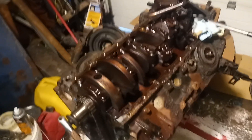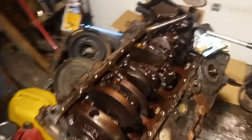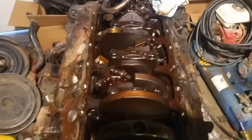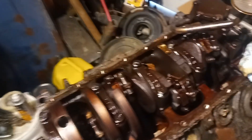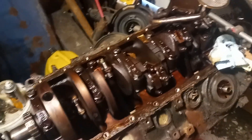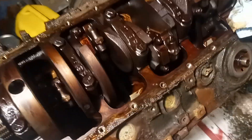Personally, I don't care what the manufacturer says with their 5W-20 — if I bought a brand new car I'd be running 0W-40 Rotella on it right from brand new. I think they recommend thin oil because they claim you get better mileage, but it's like a fraction of a percent — absolutely nothing in the end. This motor looks well taken care of and had regular oil changes; I just think the oil itself was very staining.